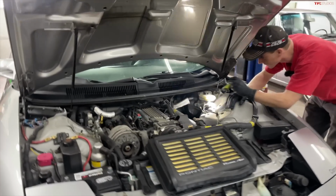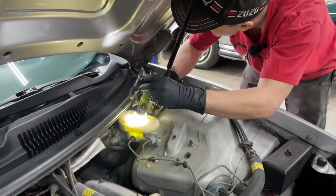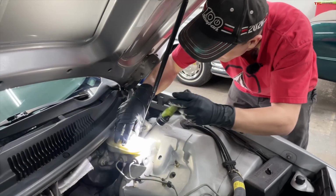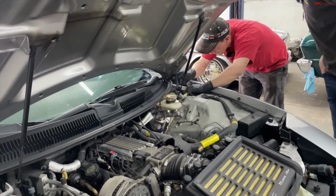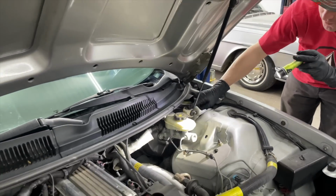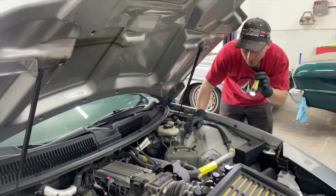What do you think of that brake fluid there? Yeah, we'll see. I've seen dirtier, but it's got some moisture. You can see some water residue droplets in it, and it definitely could be flushed. Same with the clutch fluid. It'd probably be a good thing to flush the clutch fluid out because it's got the hydraulic clutch system on it, so it's got a whole extra reservoir here for that. Gotcha. It's just brake fluid as well, but it's for the clutch.